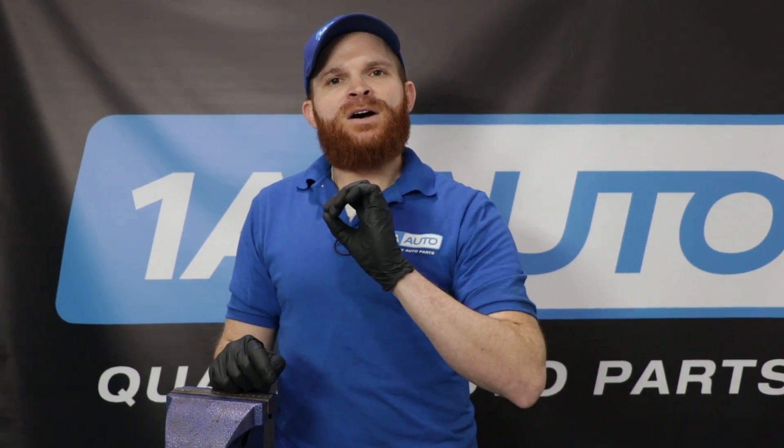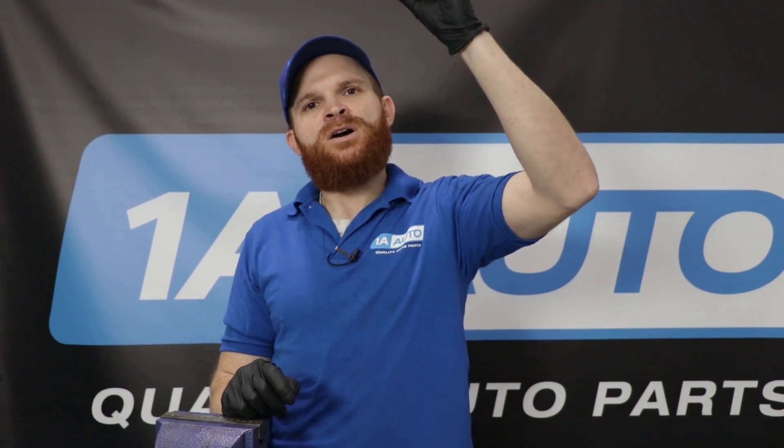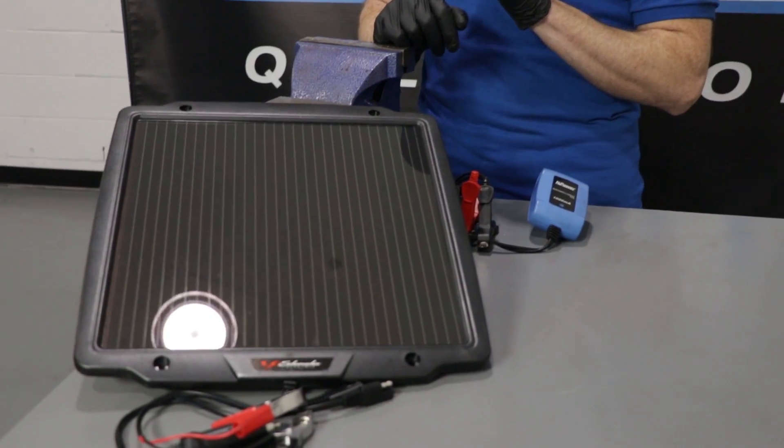When we're talking about maintainers, a lot of times people will get confused and say it's the same thing as a trickle charger. It's kind of the same thing only because they have a very low amount of current, but the difference — and it's a very big difference — would be that the trickle charger is actually just going to keep on trickling that juice to your battery, where this is actually going to know to turn on and off. If you think about a bathtub where you just leave the faucet on to drip — at first it's really not that big of a deal, but over time it's going to fill up that tub until it's full. And then if you're using that trickle charger, it's going to keep on going and come over the sides. If you use a smart charger like this, it's going to know where the battery needs to be for ultimate charge.